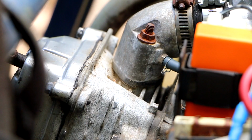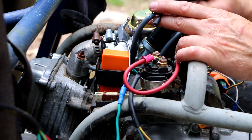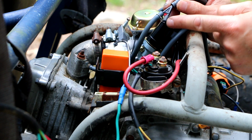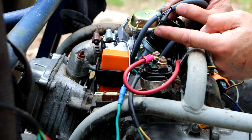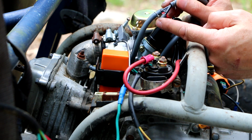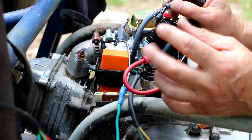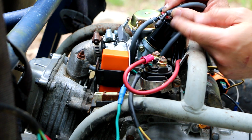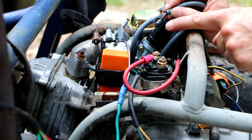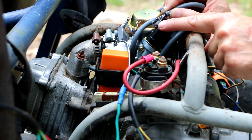That's a little better. Okay. So then that vacuum line comes up here and it comes to this T that's supplied with the new carburetor, and this T has a line that's capped off. What would go to this line is, in certain applications, I think particularly scooters that use the GY6 engines, this line goes to a vacuum operated fuel shutoff valve underneath the tank. There's a petcock underneath the tank that has the ability to automatically shut off the fuel flow when there's no vacuum detected. So my Suzuki Eiger ATV has the same kind of a system.